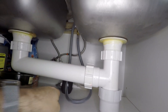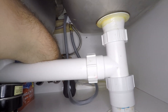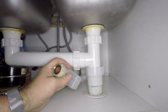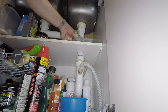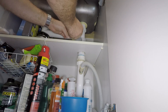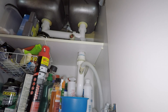The other thing to check would be the inlet pipe. I'll just turn it off and pull that out so we can have a closer look — keep in mind water will definitely come out of this one. As you can see there's a filter in the end of it which does also come out, so just double check that that's all clear. There is also another filter in there which does not come out, so don't try and pull it out. Once you've established that everything's good there, double check that the error code is still present and if so we'll move on to the next step.